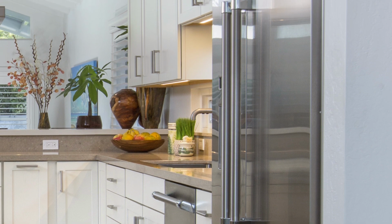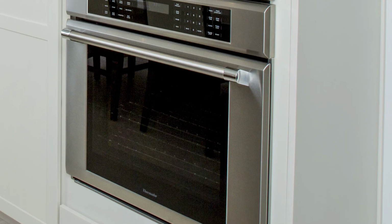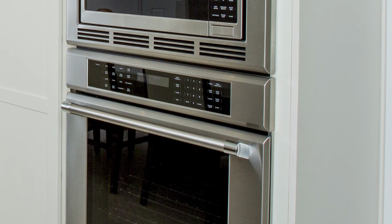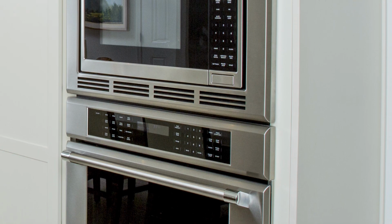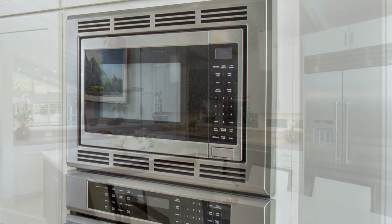dry and frozen, and on the refrigeration side, right? The food will last longer because it's not being dried out by the freezer. You have dual evaporators and dual compressors, so it's a non-shared air system. Now that refrigeration compartment is separate from the freezer.